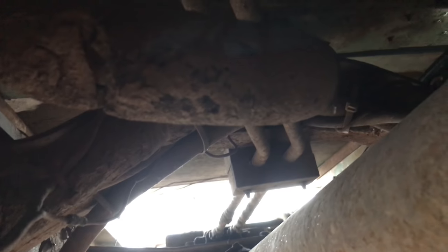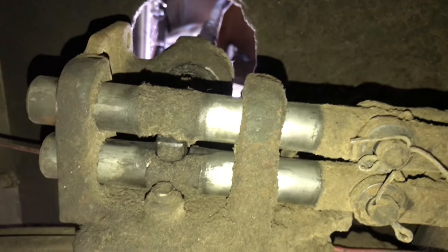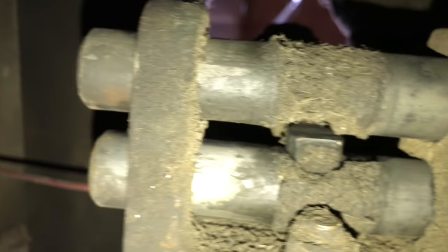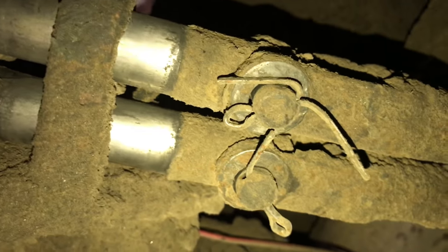Those are the two rods going off the top, running along under the floor, and there they are - they just slide back and forth. Those rods slide back and forth, and that nubbin right there is actually the stick - it runs in those grooves and slides these back and forth. But that's fairly worn, so I'm going to pull this whole mess off, take those bolts out, unhook those yokes. I can leave the rods in the truck, just take the cotter pins out, take this whole thing off and get it redone.